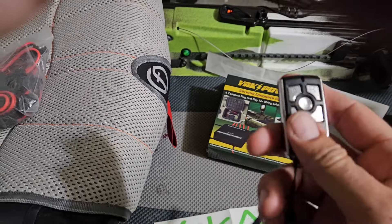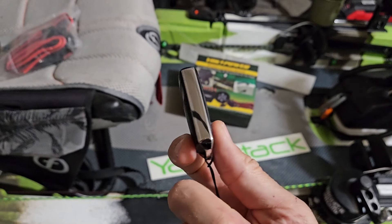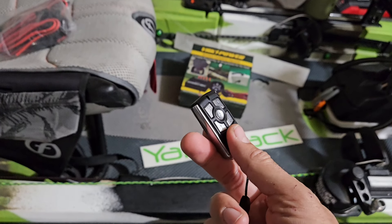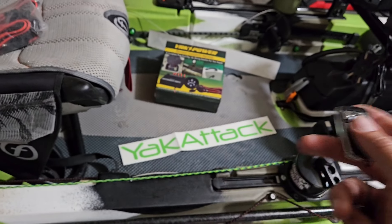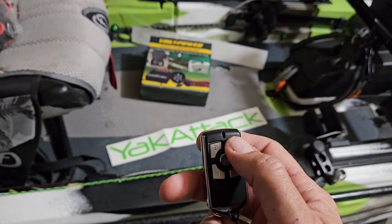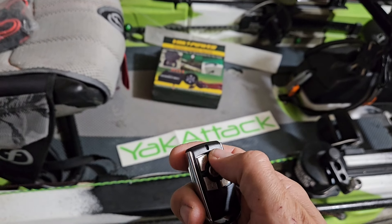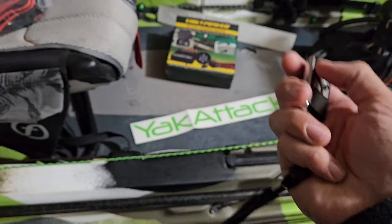Here's the remote — and these things are known for not working properly. It seems that when the battery sits in the controller for too long, the controller somehow pulls power from it and kills it. Also, sometimes the relay gets confused. What I found is that by holding the button down for a long time — maybe 10 to 20 seconds — then letting it go and repeating if needed, everything starts working again. I've never had to do it more than twice.